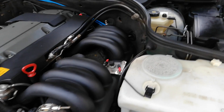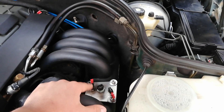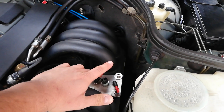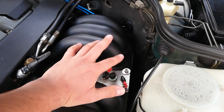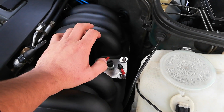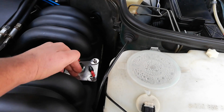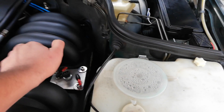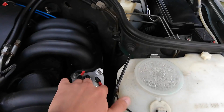I had planned to make the switchable intake usable again, but it was a failure. I couldn't get it to seal — above 0.3 to 0.4 bar the seals wouldn't hold anymore, and where the shaft from the flap goes through the plate it wouldn't seal against the shaft. So I put the block-off plate back on.